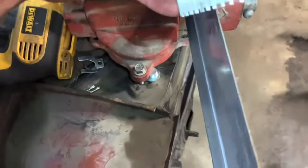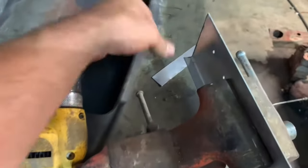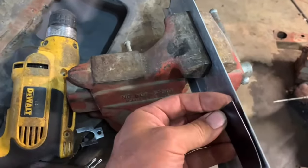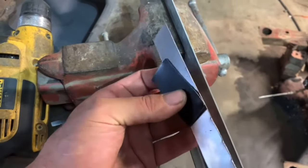Let's get started. The base metal here — let's pretend that's like a rocker panel, it's about 14 gauge. That's a pretty decent gauge metal and most of your sheet metal is 19 gauge on each car. I got some 22 gauge too because we're going to do not just two layers welded together — we're going to sandwich three layers, similar to what a rocker panel will be in some other areas of the vehicle where you're doing multiple layers.